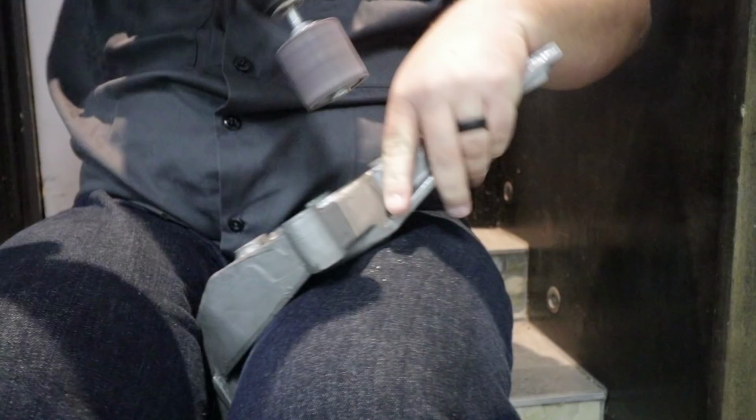I was hoping that that was good enough before and that I could throw some grease on it and everything would be fine. It totally bound up, it got stuck. I had to throw the entire assembly in the freezer and then use a sledgehammer to get it out. And I dented up my pretty spring plate end, so I had to grind that down a little bit, and I'll have to repaint that, but it is what it is. So I'm gonna get the drill out and get to work on this.